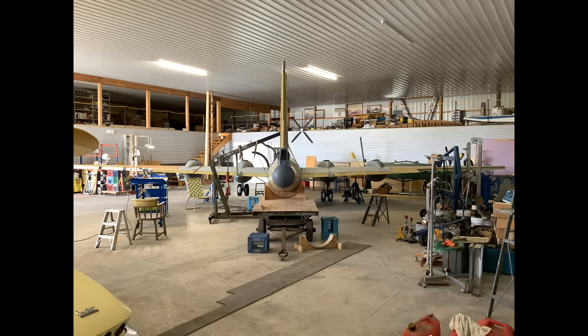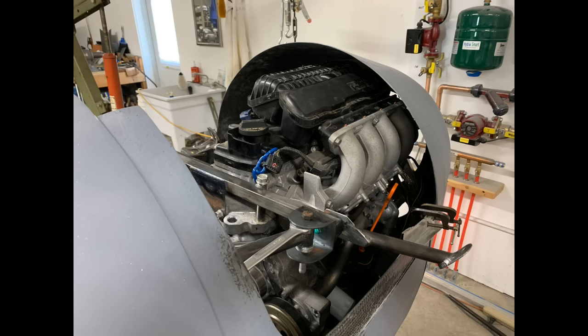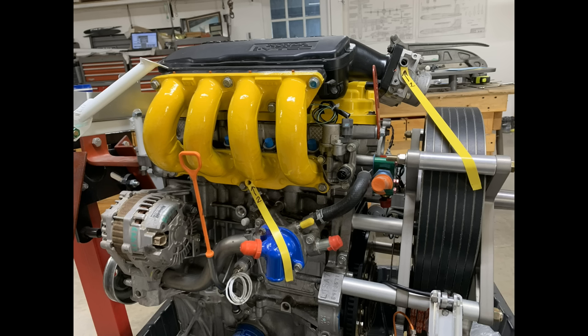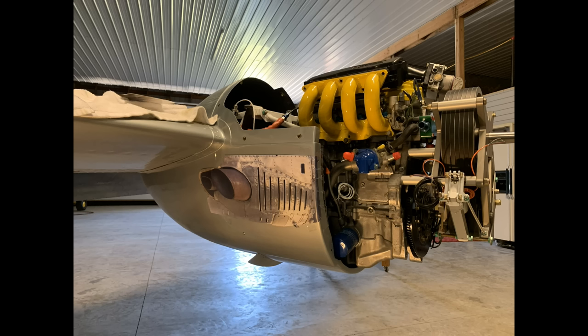Power for the B-29 comes from four Honda Fit engines, which Tom has modified a little bit. He's also designed the re-drives, which is a belt-type system. It incorporates an electronic tension-sensing device in the cockpit and has a linear actuator to tension the belts according to temperature changes for the pulleys and the belts. It also incorporates a braking device to stop the propeller to reduce drag in the event of an engine failure — obviously it would be pretty hard to feather the props on something like this, so that's a very clever addition.